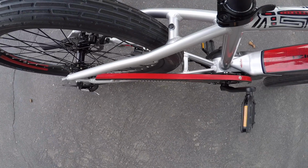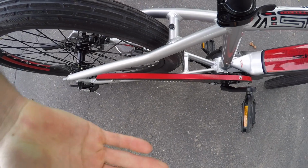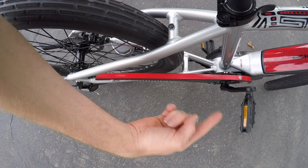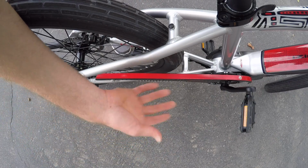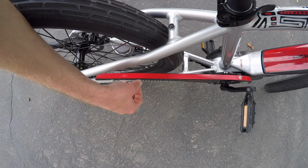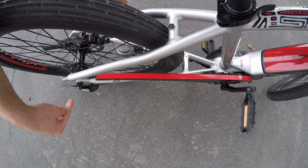You hear how it went quiet at the end there? That's because I passed the maximum supported speed of 20 miles per hour. So you can pedal faster if you want to. I can't say exactly what sort of RPM support this bike offers. Some of the really fancy mid-drives offer up to 120, which means you can spin very quickly. I'm guessing this is around 100, and it looks like a square tapered axle versus some sort of spline, something a little fancier. So again, it's a value mid-drive, but it still gets you the weight distribution and the efficiency of switching gears.